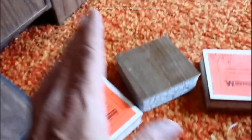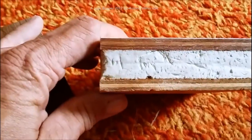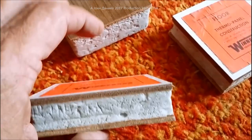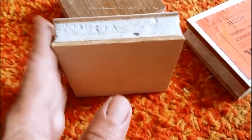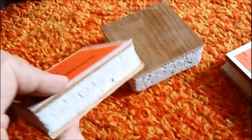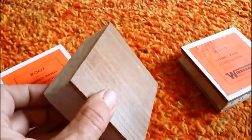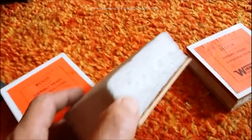What we have here is thermal panel construction. These are the panels used in this trailer. As far as the roof, this is a miniaturized version - the roof is actually about this thick of this design. It has aluminum every four feet, then regular wood, and on the sides of the aluminum on both sides is wood - a one-by-three. The outside walls use this panel design with inserts of aluminum that the outer skin is bonded to, so it has both wood and aluminum.